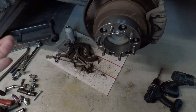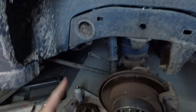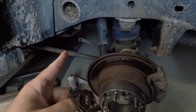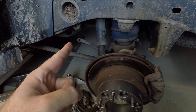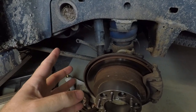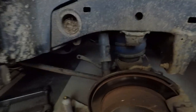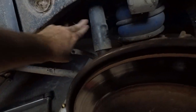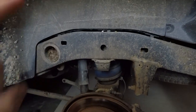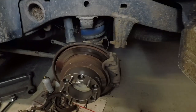We're going to leave the brake off of this side — this thing came to me without the other side of the brake so the e-brake didn't work. We are doing the mod for the emergency brake cable and while we're in here we're also doing the sway bar mod, so we unhooked one side of the rear sway bar. We have the emergency brake cable itself zip-tied up out of the way where it runs along the frame.